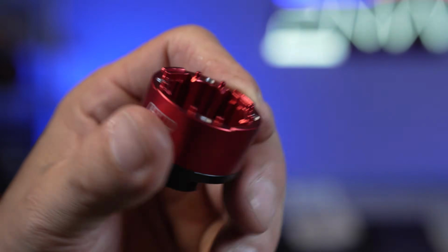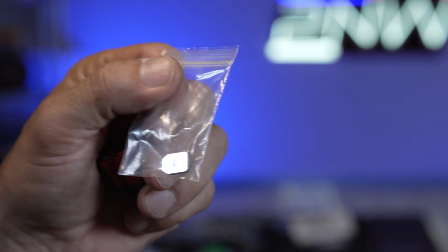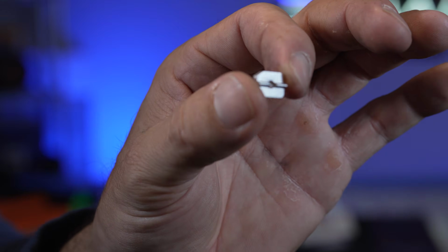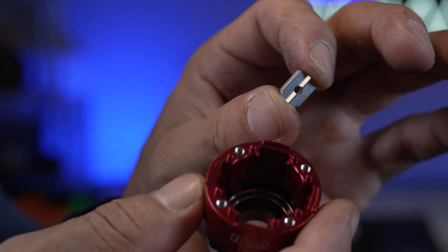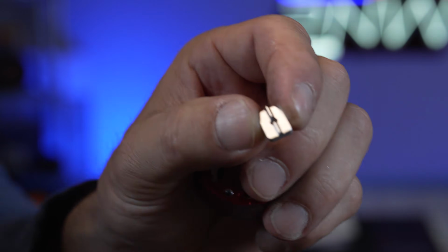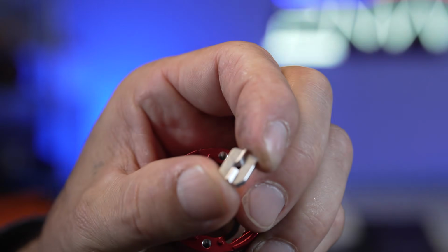And let me show you guys the awesome feature about these cases, and the PnwRcMadness diff gear spider gear spacers. So we offer these singly as well. You don't have to buy the whole set because it is kind of expensive, but definitely worth it. There are the spider gear spacers. These are 7075 aluminum, and I'm not sure which cases accept these except for the GPM. I know the Trill doesn't accept them, and the stock plastic cases don't accept these spacers because of the little groove right there. I know the stock center case does, so there is that. So we're going to be using silver, purple, and orange.